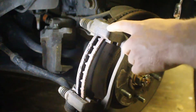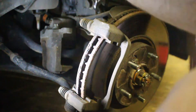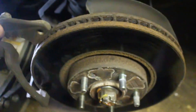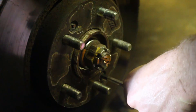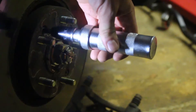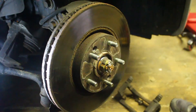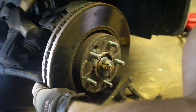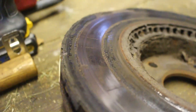In order to get the rotor off, your brake caliper mount has to come off. This is held on with two bolts on the back — they're both 17 millimeter and they usually take a little more persuasion. Once you have those two bolts out you can take your caliper mount off. The rotor is only held on by two Phillips head screws. Both were too rusty to get with a regular screwdriver so I had to use my impact screwdriver. Now that the screws are out it should pop off — I had to loosen it up with a hammer. Wow, this thing was frosted on there.